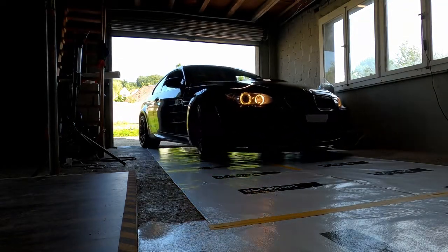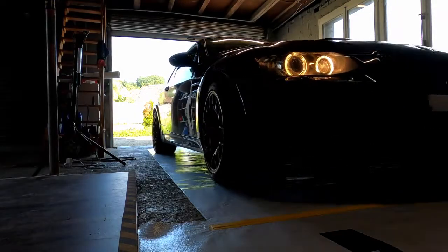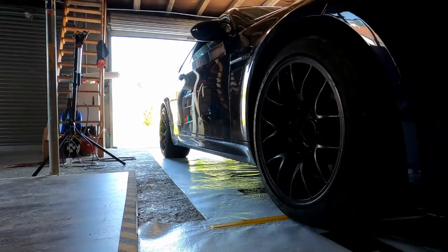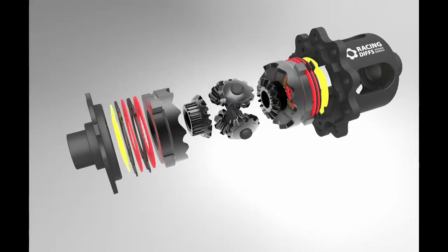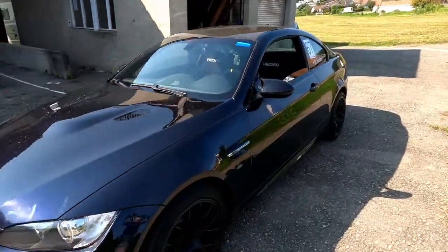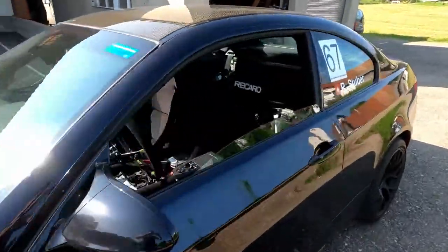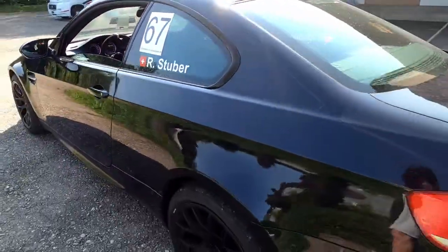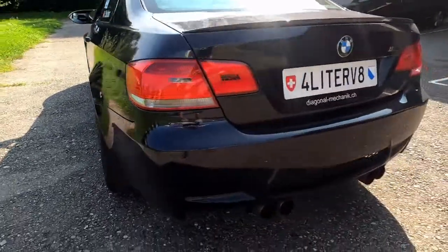It does that by means of friction plates inside the differential. From a performance standpoint, this is kind of genius, but it also comes with a price. Meaning mechanical stress is higher than in an ordinary differential, therefore the demand on the oil is higher too. So it's probably not a bad idea to change the oil, especially if you track the car like I do.